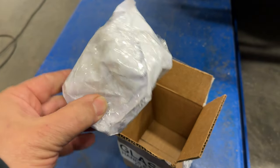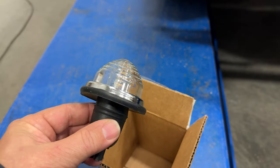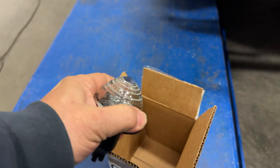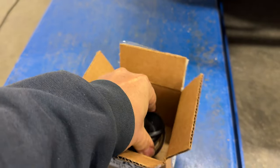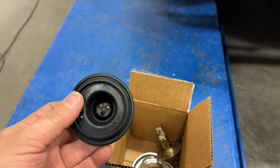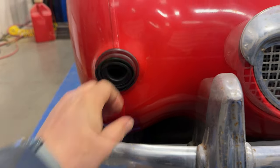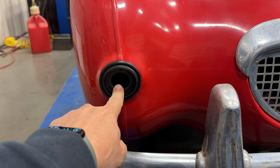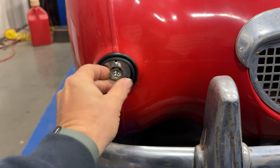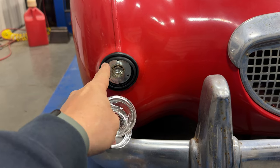That's interesting, didn't expect it to be packaged like that. This looks great. I will have to take this apart and need to pop this glass off, because this is going to be put on first, and then the wires need to be pushed through this rubber grommet and hooked up to the socket. The socket is what holds all this on after it's screwed to the car. The bezel holds the glass and the grommet, and that's what holds these two pieces on.